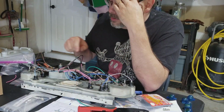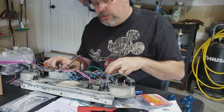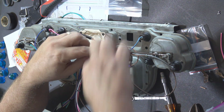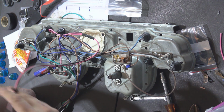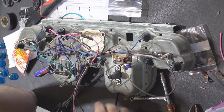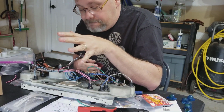Oh yeah, we got it ground too. So with the voltmeter, you actually have to run a ground connection, which has got to run over here. So you can see this light brown wire, because I didn't have any good black wire, runs, loops around, and comes into here. This is the ground, which is also what this grounds to, here to this connector, which then I guess grounds to somewhere else in the harness as well to complete the ground of the body and chassis and whatnot.